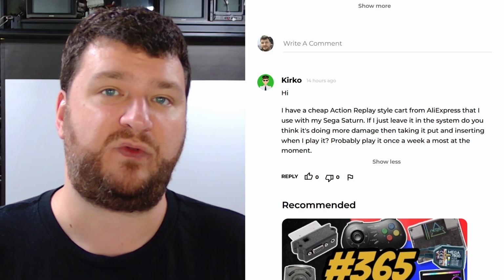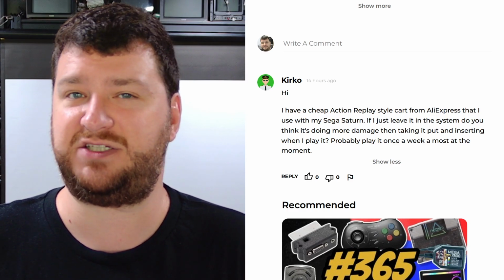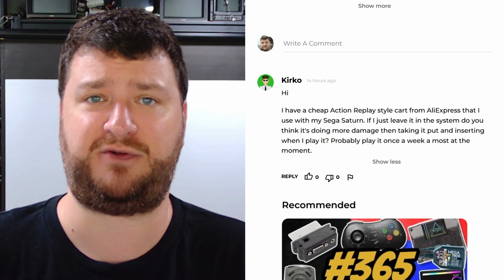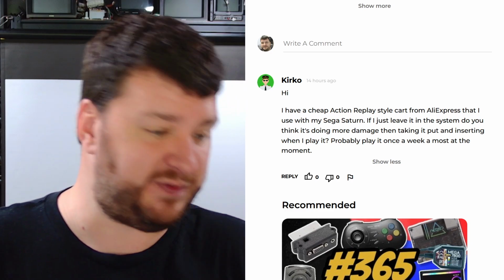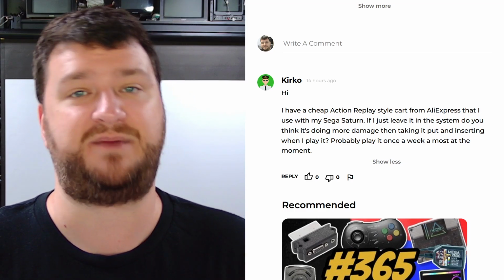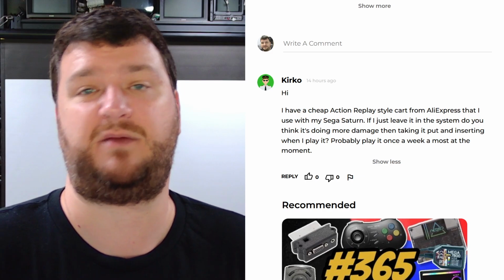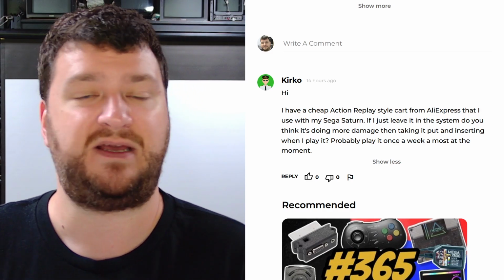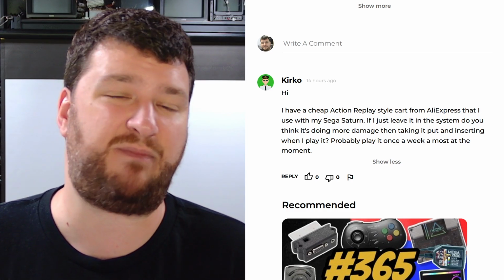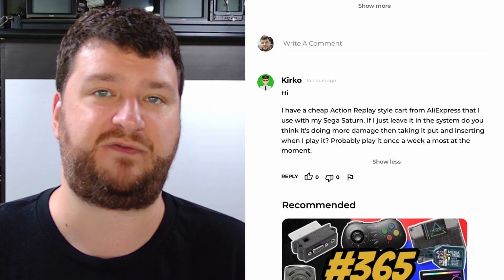I don't know the true answer, but my gut is telling me leave it in. Leave it in and just kind of hope for the best. Because if it is the proper thickness, you should be fine for a long time. If it's the improper thickness, you're going to be doing the damage anyway, but at least this way you don't end up smashing those pins every time you insert it. Now, if you need to take it out, if there's a game that's not compatible with it, if you have to swap to something else, that's one thing, do what you got to do. But if you have the option to just leave it in, I probably would do that and just kind of hope for the best. And there were a couple of options being floated around.